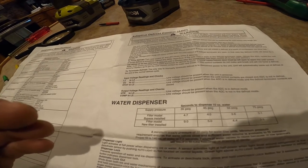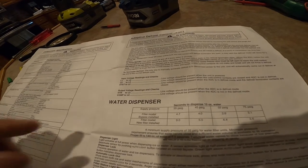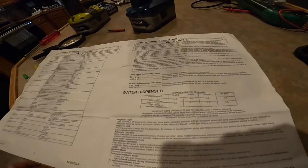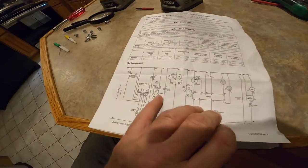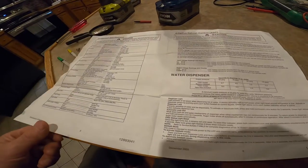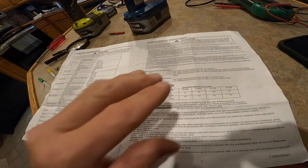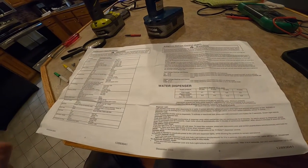So now I'm in between whether it's the thermostat or the actual heating element, and I'm thinking it's the thermostat. Because I went from stat to L2 — the line voltage should be present in defrost mode and it's not. That should tell me right there that it is the defrost thermostat. The stat wire is orange and white wire is the common. There's no voltage present when the thing is in defrost mode. So I'm thinking it's that little $15 part.